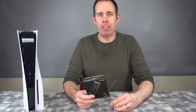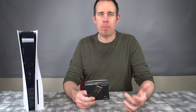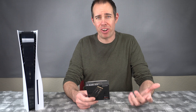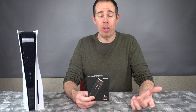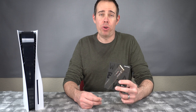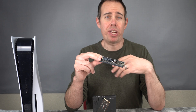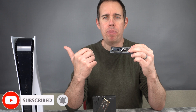I'm pretty bummed that the Gen 3 I had laying around did not work in the PS5. I was kind of hoping it would work, even at a performance hit, rather than shelling out another $200 for a one terabyte that does work. But at least we both know now that you cannot use Gen 3 at all — it needs to be Gen 4 or greater, 256 gigs or higher, with a maximum of four terabytes. Now all isn't lost — if you have an NVMe drive that doesn't work internally in the PS5, you can simply buy a USB enclosure for it and plug it into the USB port on the PS5.